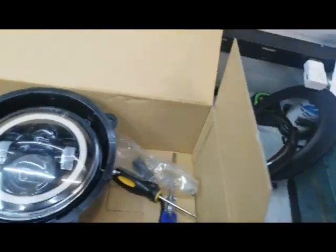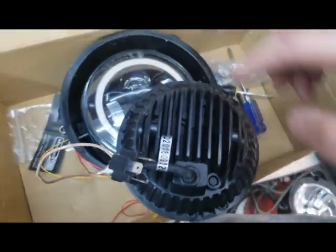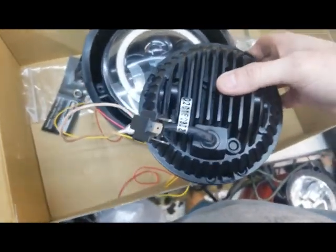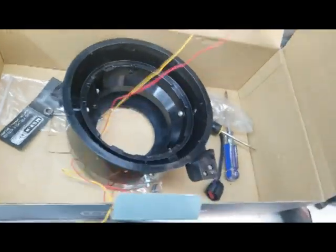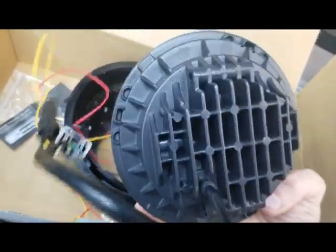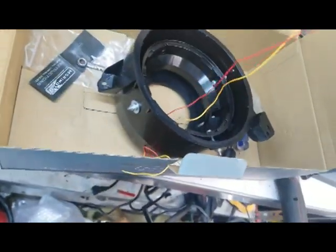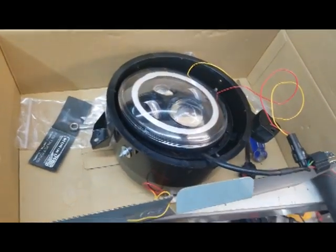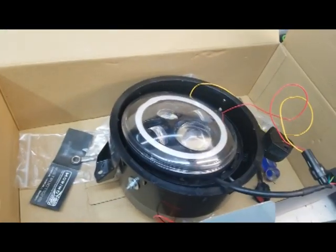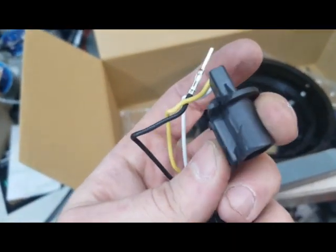The driver side is in. The way these work, there are locating tabs - a tab here, tab here, and a third tab here. I got nervous thinking about using different lights, because the whole reason I bought this was to try out different lights. These are the cheapest lights I could find on eBay, and they also have those locating tabs. So you should be good with pretty much any aftermarket sealed LED light. These cheapos have a halo; these are the Morimoto's that are supposed to be better. You can use other ones if you want.